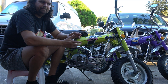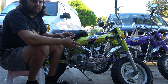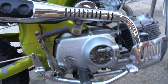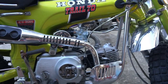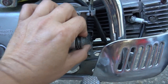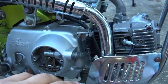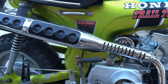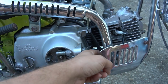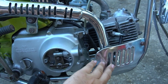First thing I'll do is walk around the bike and show you the things we'll be swapping, then we'll jump on the computer and start picking our parts and make the orders. We're looking at the OEM engine in place here on this H model 4-speed — you can see it has the manual clutch arm. So the Lifan engine is going to have this same front clutch lever design. I'm going to put the bigger bore pipe on here, though I may have some clearance issues since that pipe is probably bent just a little bit differently.